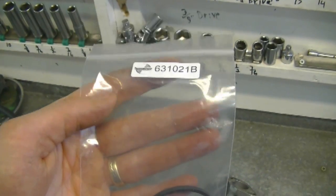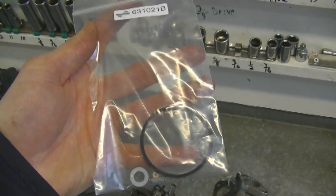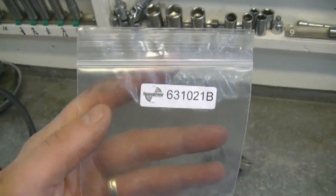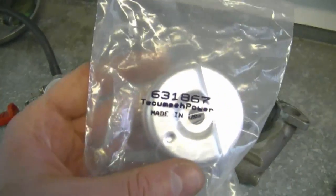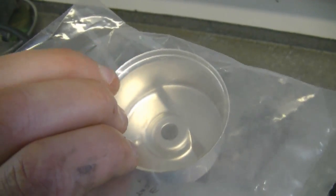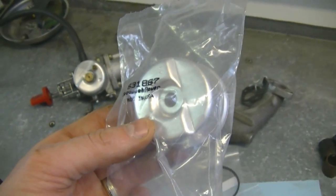I do sell them to people in a jam — I can ship to the US or Canada for seven dollars including shipping. If you can find it cheaper somewhere else or at your local small engine shop, that's good too. Now, the bowl for these carburetors is number 631867. If you see corrosion where it contacts the carburetor, you should replace it because you can get a carb leak. These bowls are pretty cheap, under five dollars, so replace them when doing a complete carb rebuild.